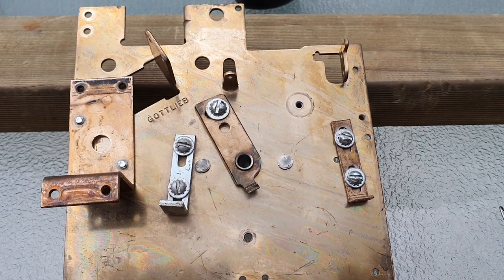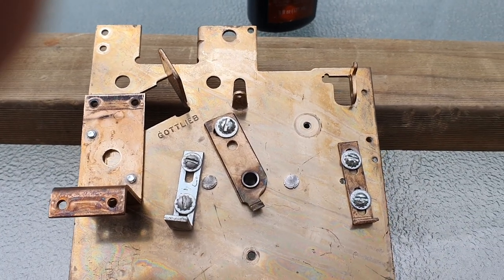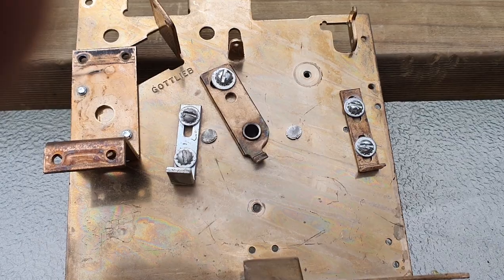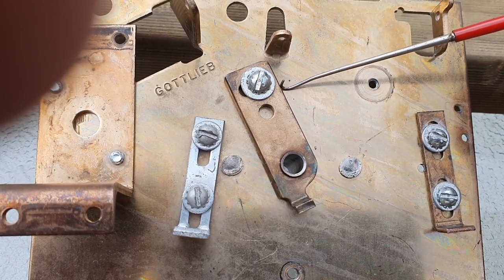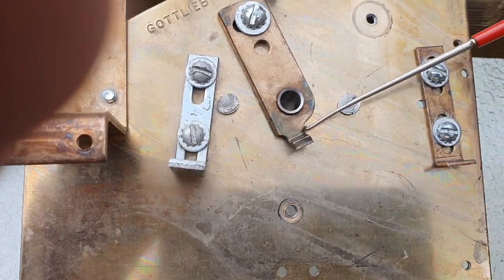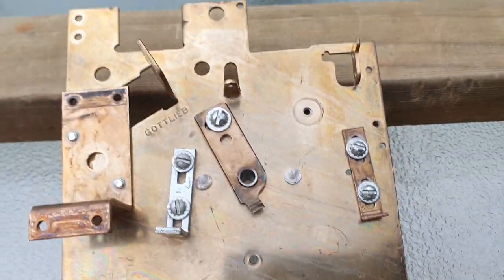There's the drive arm and drive pawl, and this here is what they call a detent — that's a spring-loaded lock. I've spoken briefly about detents before; it releases when you step up the first time. There's the wiper finger assembly with the wiper fingers and springs — they've all been cleaned, and the tops have been cleaned. Here's the frame. Like all good manufacturers, Gottlieb decided to use the same frame for all their machines. The major difference with this one compared to the 0-to-9 unit we did the other day — that was a one-way stepper.